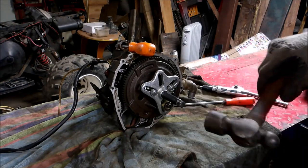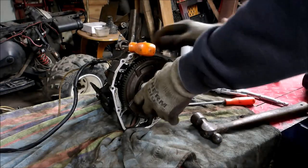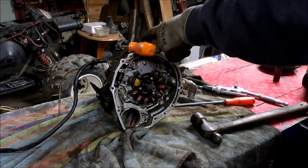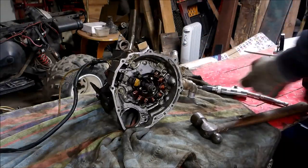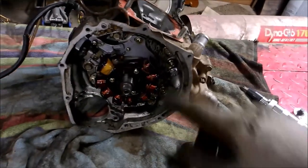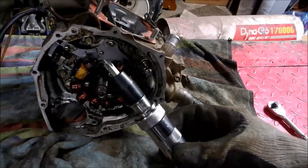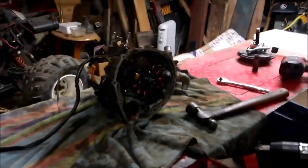Sometimes you just give it a couple of wraps after you've got the wheel puller tight and she pops right up. Put a screwdriver up here to hold the crankshaft in place so it won't spin. Next we want to take the stator off. A lot of times those stator bolts are hard to get out — there's one here, one there, one there. I've got a special punch tool that punches and twists at the same time and breaks the bolts free.